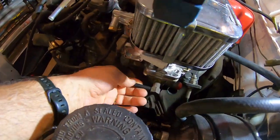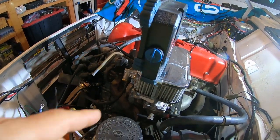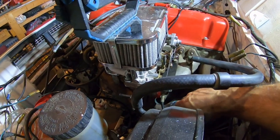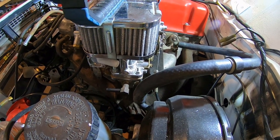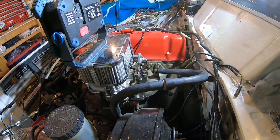I found a vacuum port on here I don't need, so I plugged that. I've got one vacuum hose, one vacuum line, one plug. I still need to order a PCV hose that goes here — it's like 32 bucks. I finally found one; I was looking forever. Last time I bought one was at the dealer in 1984 for like eight bucks.